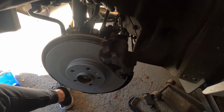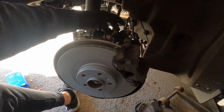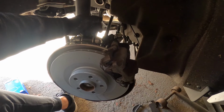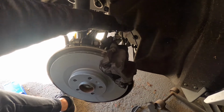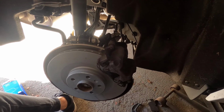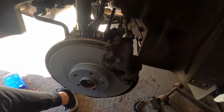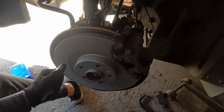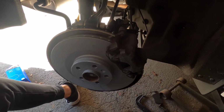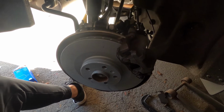Really easy. The trick of reversing the gear with the battery on the emergency brake saves everything. So this is a little loose, obviously, but once I put some pressure on the brake and push that fluid back into the caliper, we'll have a nice firm brake pedal. So let's finish the other side. I'm going to do it off camera so it's faster for me, but that's pretty much how it's done. It's a rinse and repeat on the driver's side here.